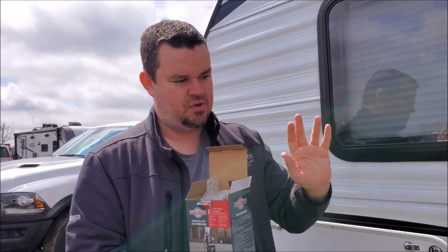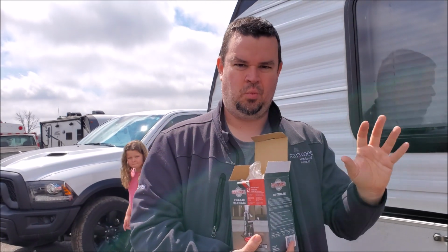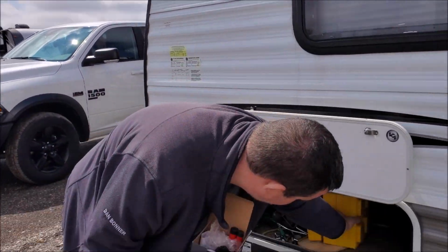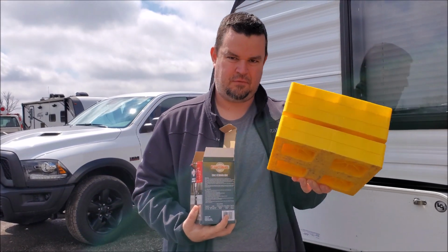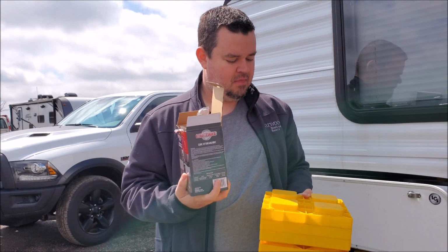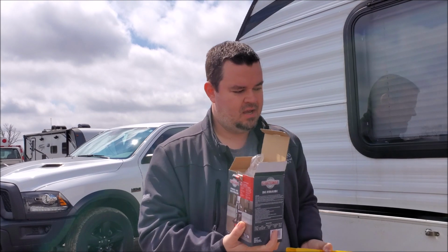Now you have to be very careful with it. You have to make sure that you're only lifting, of course, one side of the trailer at a time. You've got to make sure that you chock the wheels on the opposite side. The other thing that I did was I have some of these Camco leveling blocks, and I'll put the link in the description to my review video of these. Great product. But what I did was I actually put the bottle jack on top of the leveling blocks to give it just a little bit of extra reach.